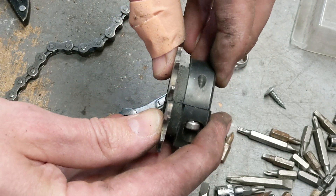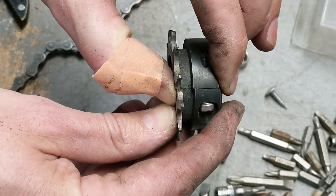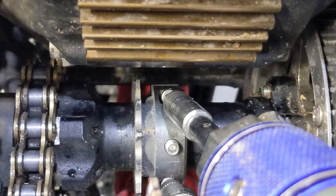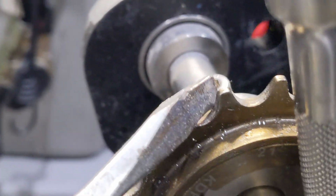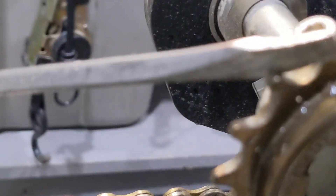It's a disappointing design because you can't see very well when you work over there. You want to make sure it's perfectly aligned, because if the teeth are not aligned it's going to break your chain. All my tools are jammed in there. On this side of the sprocket I got it pretty lined up, but I cannot put my finger in there to feel that edge and make sure the teeth are aligned — and they are not. The solution I came up with: if you find a split, put a screwdriver in between the teeth and push this way, or put it on the other side and push until the sprocket aligns perfectly.